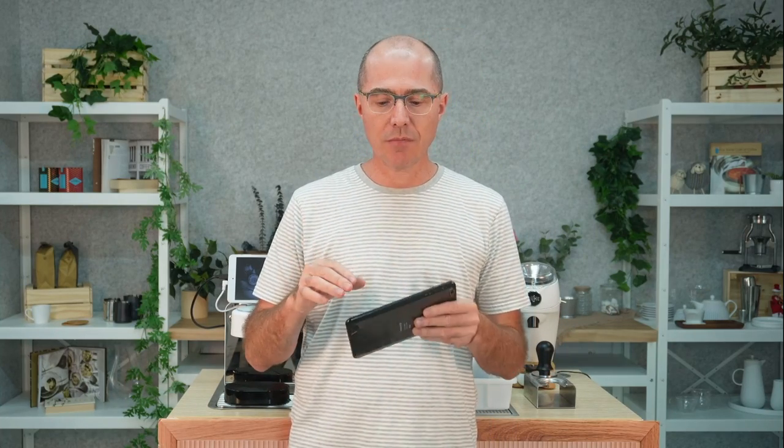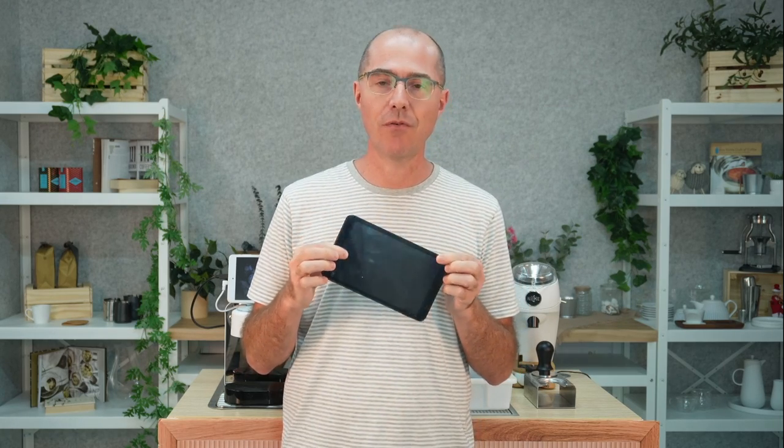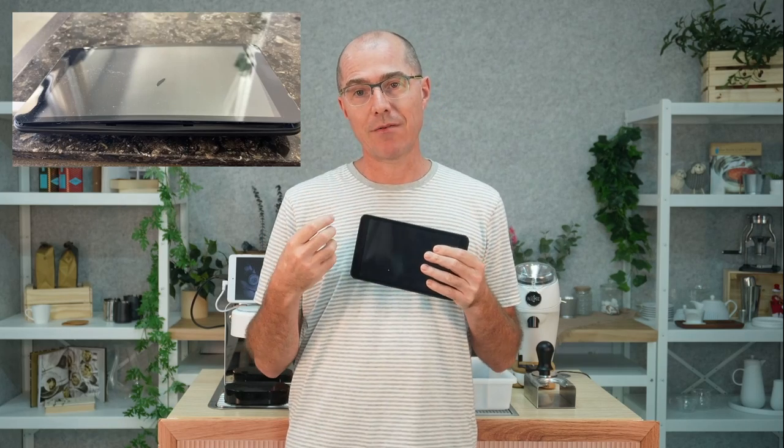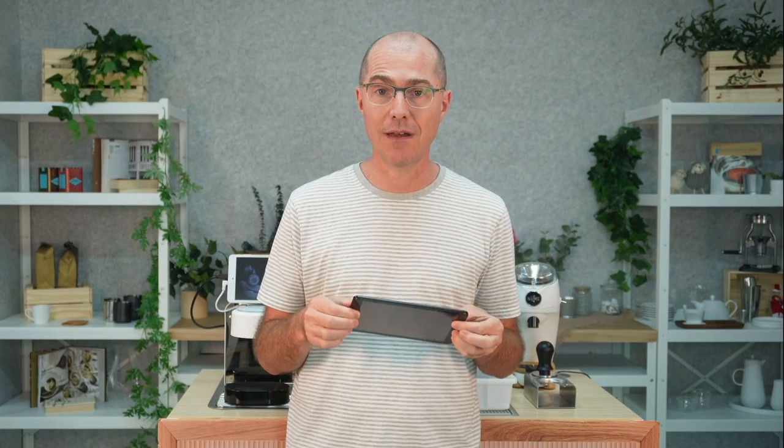In this video I'm going to talk about how to replace the battery inside an Android tablet with a power supply. There are a bunch of reasons why you'd want to do that. The first is that if you are using a tablet or some other device like a phone and it's always on, it might swell the battery with age. This is particularly a problem with Android — the Android operating system still doesn't have smart charging. Samsung devices do, but Android's global OS does not. Without smart charging, any Android device that's plugged in all the time is going to have a battery that degrades kind of quickly.